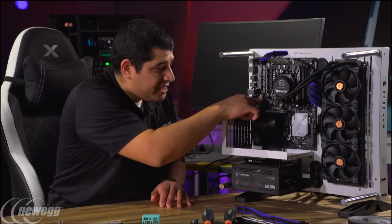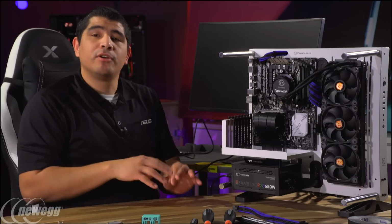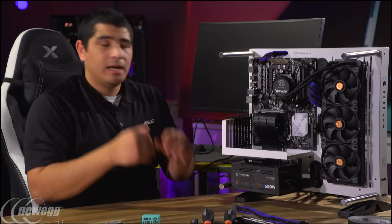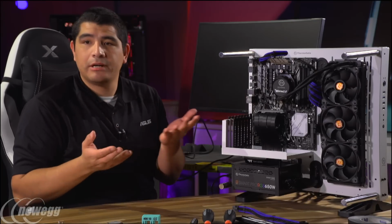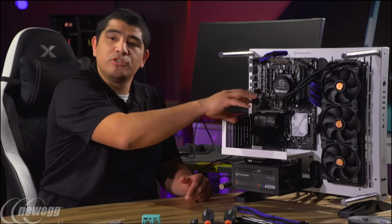So they're by default usually just need a full output voltage, and they're not going to vary. There are newer pumps that have now come on the market that are PWM based, and they vary. In that situation, depending on the pump design, because we do have PWM support, we could optimally support that. So in either scenario, you would still want to use the pump header. It's just really up to the type of solution that you have.